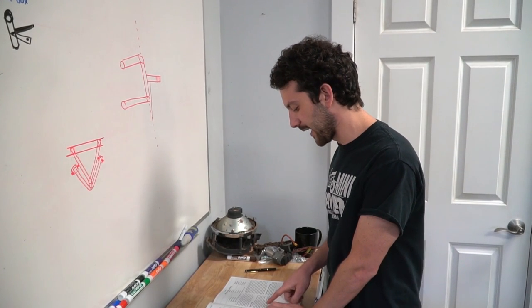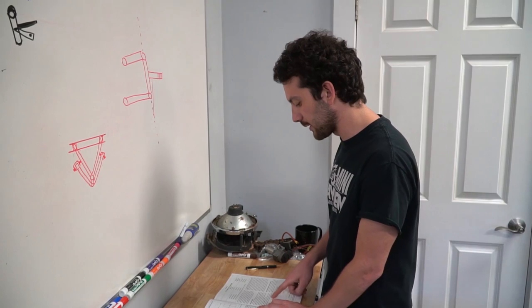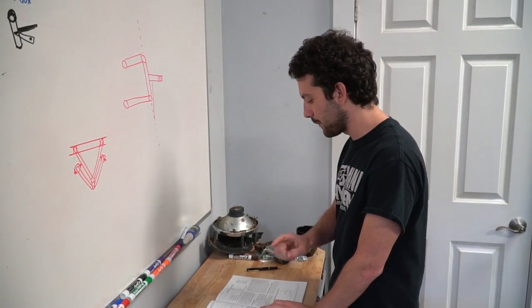Knuckle design and ball joint heights. Since all the loads from the wheel and tire must be fed onto the chassis and control arms to the upper and lower ball joints, it is an advantage to place the ball joints as far apart as possible. It could be better on the front of ours. Well, we were using small wheel diameter, trying to keep... It'll be fine. Small wheel diameter.